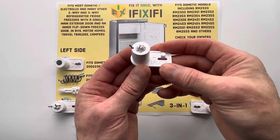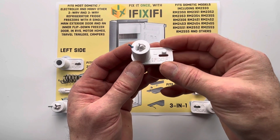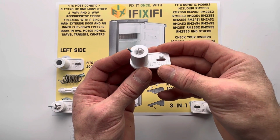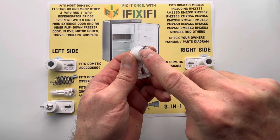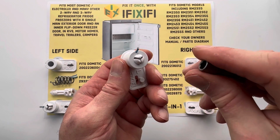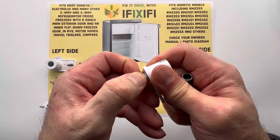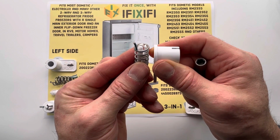If you want to take apart your old spring assembly, you'll need gloves and eye protection because there's a good chance that the old plastic or old metal has become brittle and there could be sharp flying fragments. First, you'll need to compress all 3 prongs of the hinge pin so they squeeze back through the hole in the barrel of the spring housing. I'm doing this with a socket bit from my toolbox. If your plastic parts are old and brittle, this can break the prongs of the hinge pin or can break the spring housing.